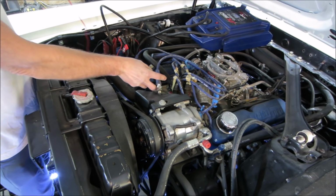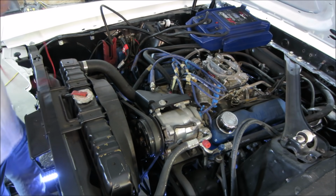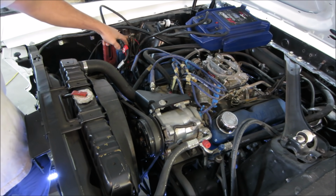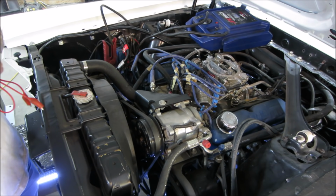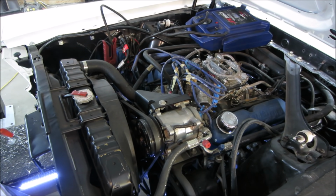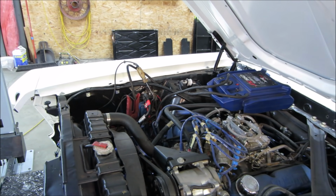No spark. So it has something to do with how that's tied in there. So the key's off, no spark. If I just go to try to crank right on the starter. What a weird setup. Boy, this one's got me going a little bit. Now, rightfully, I got that wire off. I should turn that. That light should light up. That's the signal coming from the key. See if we get anything.